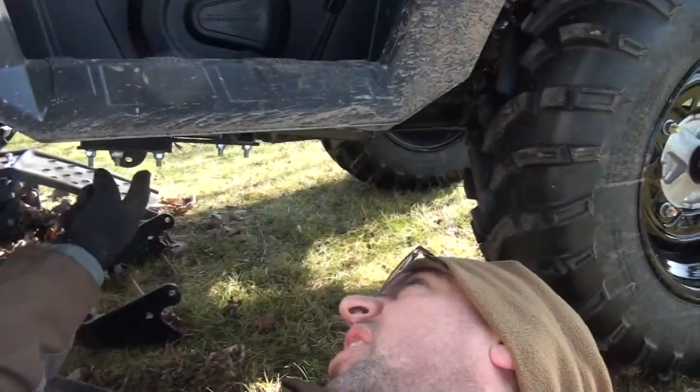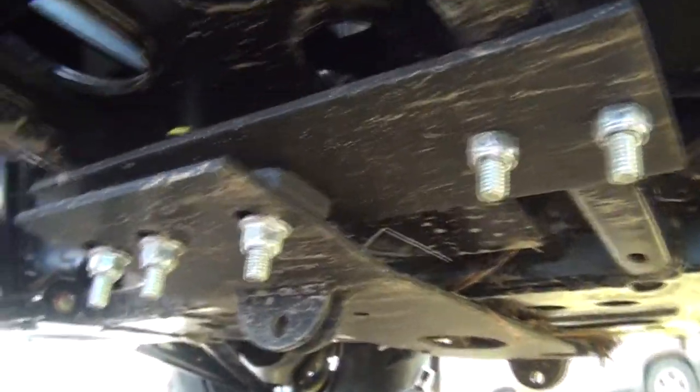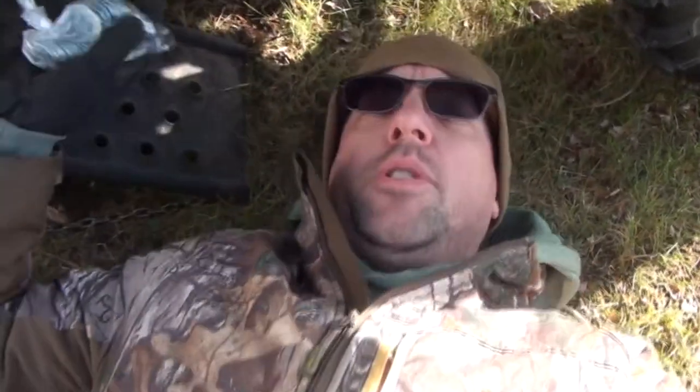Here's the plan: there are three bolts holding the mounting bracket under the belly of the four-wheeler. We'll pull each of these bolts and nuts off the threaded bolt, then shim it up using some washers I picked up at the farm store. Full disclosure — I did make a mistake because the kit did come with some extra shims, but I ignored that part and pitched the extra pieces that they included to use as shims. So I'm stuck using washers of various thicknesses and diameters to get this done.